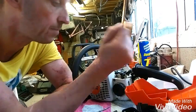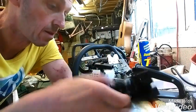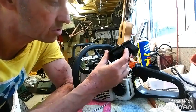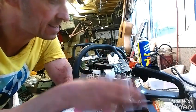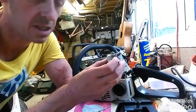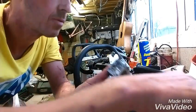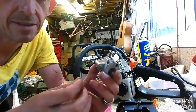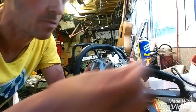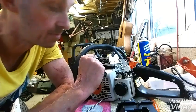Pull the carb to pieces, which is quite simple. You take this top cover off, which is on here - you take that off. The air filter is held on here with two bolts which come through to here, they attach on the back, and then once that's off you'll find the carburetor, which is this thing here, which then pulls off. We've pulled that off - when you take it off you end up with these on either side of it. When we pulled them apart we had sawdust and things in them.